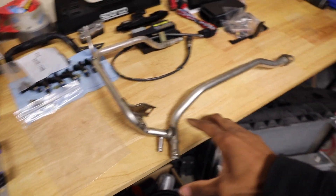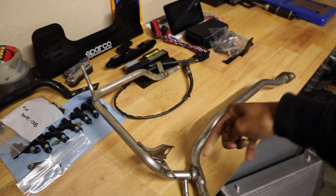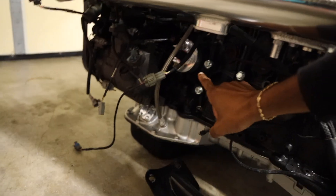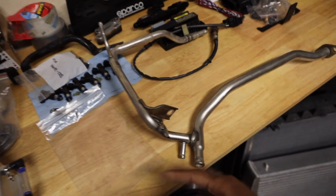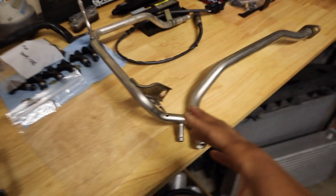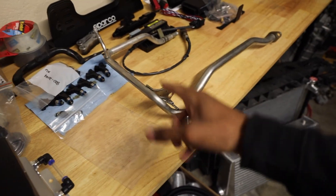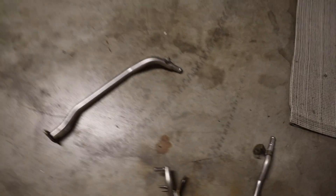What is the deal y'all, we are back in the garage with the 2JZ. Right now what I'm about to get into — I'm actually about to cut this pipe right here. This is the factory coolant pipe that would bring coolant from the water neck all the way around to the heater core as well as going to the factory oil cooler. But since we no longer have the factory oil cooler — we're running a sandwich plate and remotely mounting our oil cooler — we actually need to go ahead and chop it right here. I will be keeping heat in the car, so I do want to run a coolant line to the fitting on the car.